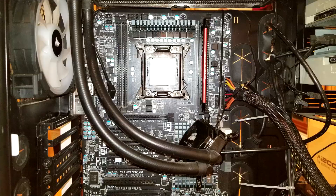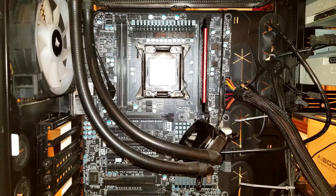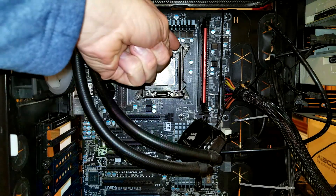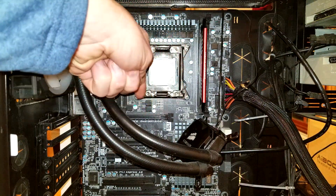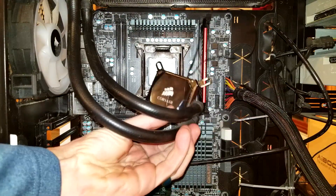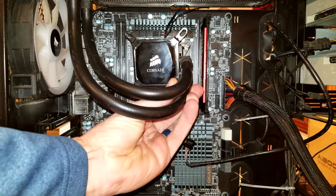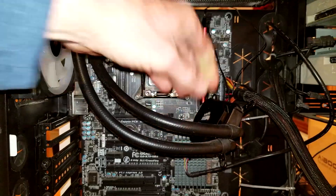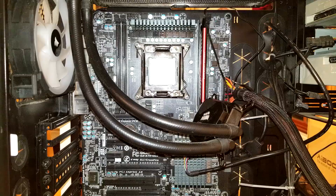To get to that step, obviously have the computer off. My cooler just had four nuts, one on each side — top, bottom, left, right. Go ahead and unscrew those lefty-loosey, and the cooler just slips right off. Go ahead and put that off to the side. I already took one stick of RAM out — just make sure it's not damaging anything else.